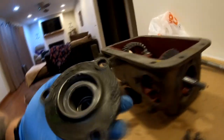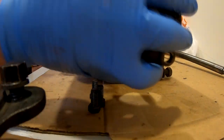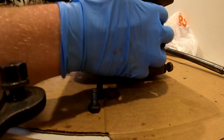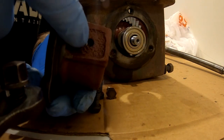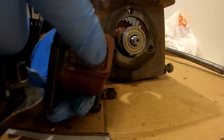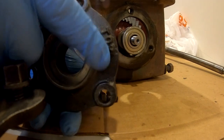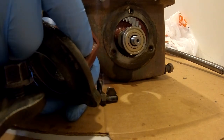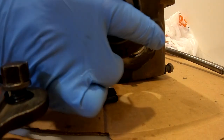This is marked 'top' so you know which way it goes. One important detail: there's an oil reservoir or oil catch on the top side — make sure it's lined up with the top. It can't move because it's cast as one piece, but make sure that oil trough is towards the top side of the governor.